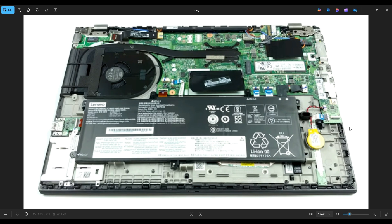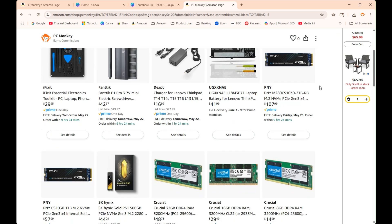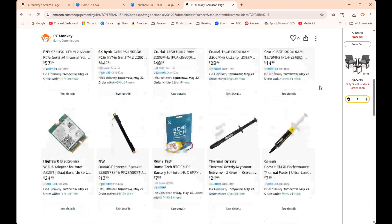After you do, this is what you're looking at for the inside of your computer. As a general computer repair side note, whenever I'm working on a computer in my shop, it's sitting on an anti-static mat. Either that or an anti-static bracelet are great ideas to avoid damaging things in your computer. If you'd like help with tools, supplies, or replacement and upgrade parts for this specific model — the T15 — I will have a link above and also below in the description.